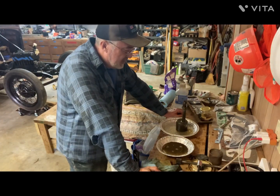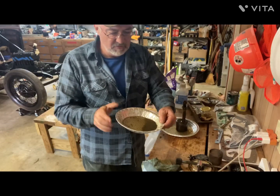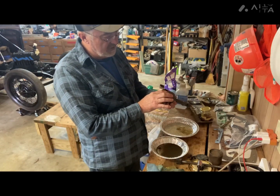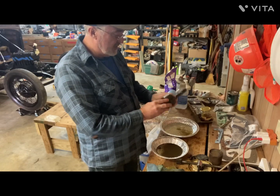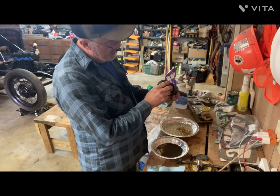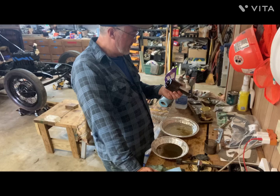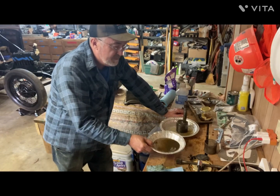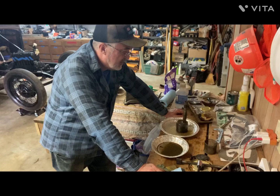After cleaning the oil pump for a while you can see what came out of it — it's pretty nasty, and there's even more grit besides what I already beat out of it. The cover is welded together so you can't really take it off and get in there. The best I could do is pour paint thinner in there and shake it to get what was caught inside, because once you put the screen in, that's going to be on the clean side of the oil and it'll suck right into the oil pump. I'll do some more paint thinner and then start putting it back together.